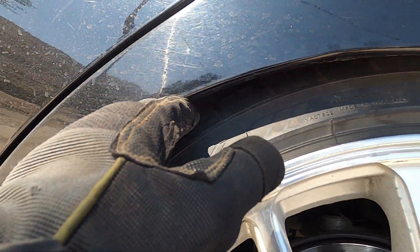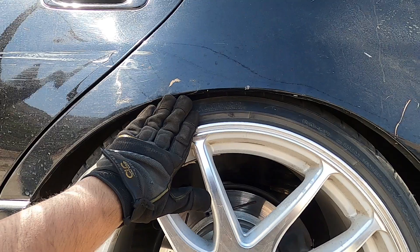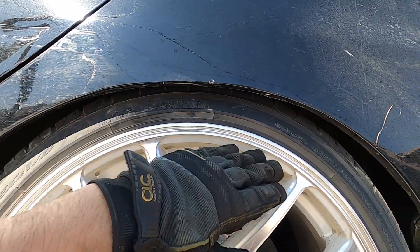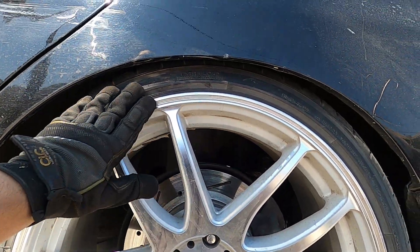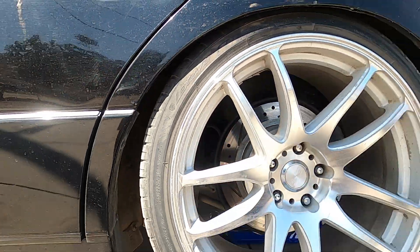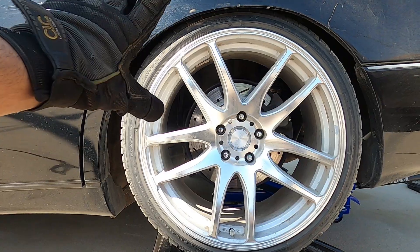The goal is I want to be able to show the entire tire in the rear. The reason I want to go higher up is because I'm having too many issues going to driveways — it's just becoming a pain in the ass. I also have burner tires for the rear when I do drift stuff, and they're significantly taller because they're stock 350Z rims. I need to adjust this so I can clear the stock rims. I'm going to get it back in the air, take off the tire, and show you exactly how to adjust the coils and what you need to keep in mind.